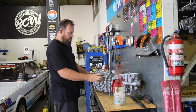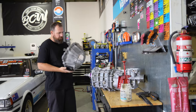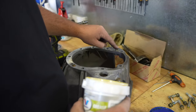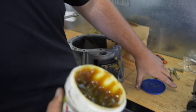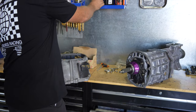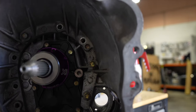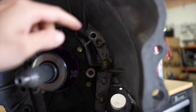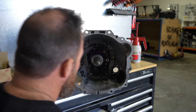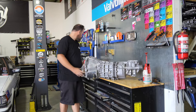Did you choose the purple? I did not. X-Clutch has used purple for a long time on everything. Because that dowel — I'm actually going to knock it into the transmission once it's bolted up, because it's clearly not gone all the way into the case. It's just kind of sat, not engaged. So you want to punch that dowel through into the case because it's not actually lined up. See how that's engaged on both halves. And that is done.